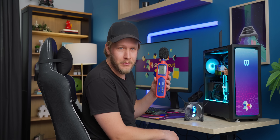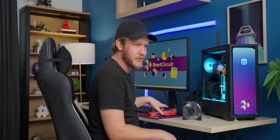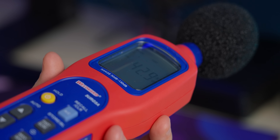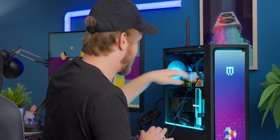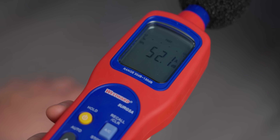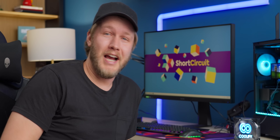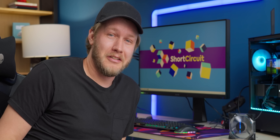Bell says it's way quieter at nine volts, which you don't get from a computer, but I'm willing to try it. I got my sound level meter because I think their specs are horrifically wrong. With the fan unplugged, this system is roughly 43 decibels. Now plugging in the fan, we're looking at about 50 dB, or 53 dB from a foot away. That's 20 decibels more than they claim, and 20 decibels is a lot — it's a shocking amount. Three decibels is a doubling in power. It's logarithmic.